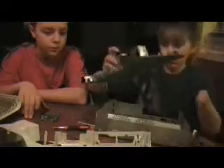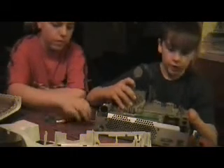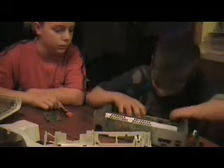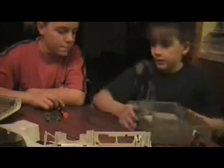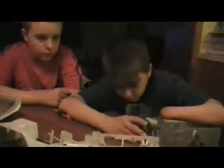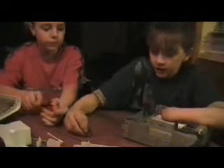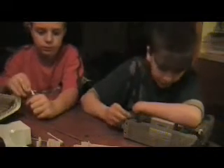Next, you just want to put your motherboard back in. Make sure you have it evened out — you've got to be really, really careful to even this motherboard out. If not, it will not work properly. Your little tabs bend and they snap straight into place. Then you want to take your chip thing that you have on the front, and there's a little plug-in right here. When you plug your chip in, take three of your Torx 8 little black screws and put your screws back in, right up top.